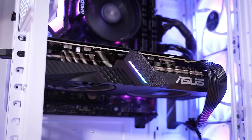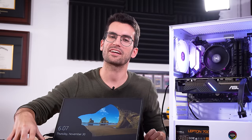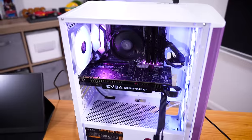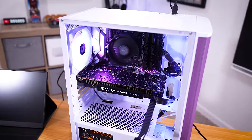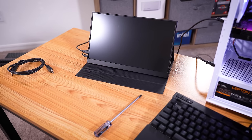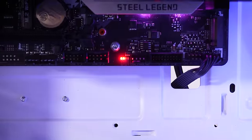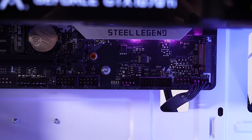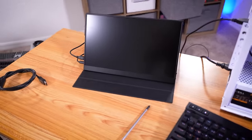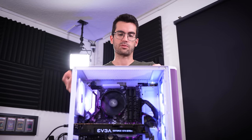The solution here stands and I expect this will be what we end up going with, but I still want to try this graphics card one last time — one final hoorah. I doubt it's going to work, but I feel like I owe it to myself and all of you to at least check. VGA and boot LEDs are lit right now — now they're both gone. Should be seeing something on screen right about now, but it doesn't look like that's going to happen. Shot in the dark, but now we know for certain it's card-related and not motherboard, BIOS, or power supply related.